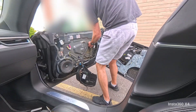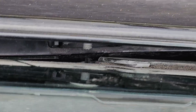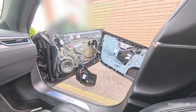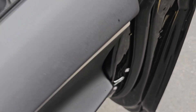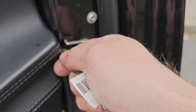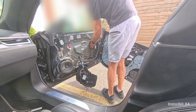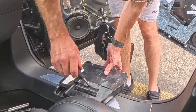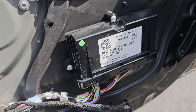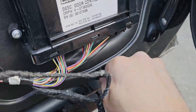Now I will try to install it back inside the door. Make sure the handle is hidden and disconnect the cable. It wasn't the easiest task — it took many back-and-forwards to get the alignment right, and it turned out that the depth changed after removing the mystery element. I quickly tested if it's working correctly, but I had to take it out again. The screw to adjust the depth of the handle is in the middle of the back cover. Depth is more or less okay, so I need to make the gap alignment perfectly straight. Make sure the door handle cable is routed correctly inside the door. I should order two repair kits and replace the third microswitch too — I might need to do this job again someday.